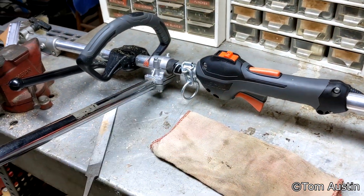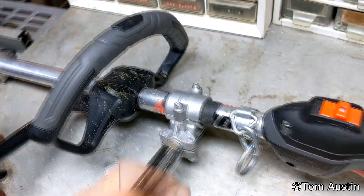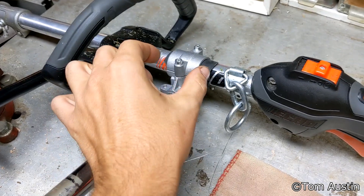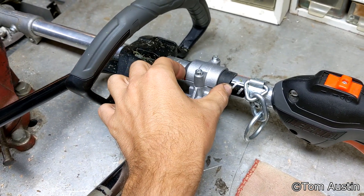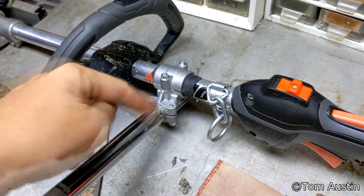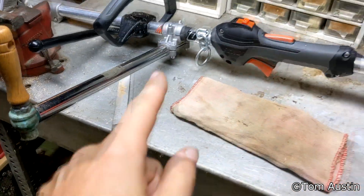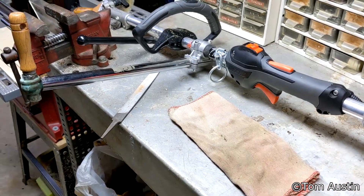It was a little too big for my brush cutter, so I just took a piece of inner tube — which I keep here under the desk — sliced off a length slightly longer than the clamp, split it in half, wrapped it around tight, clamped that down, and it is rock solid. Keeps you from accidentally crushing the pipe too.